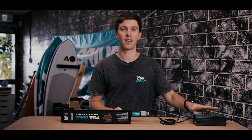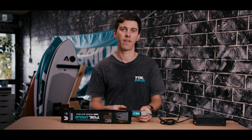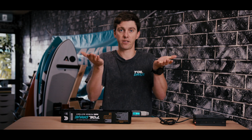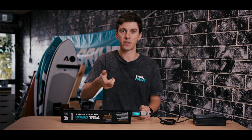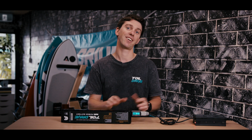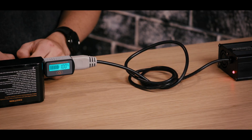Use the battery charger — when it goes to solid green, that indicates the charge is finished and you're completely full. Think of it like filling a bucket with a garden hose: you get strong water flow to fill most of the bucket quickly, then right at the end you're adding just little bits of extra water to fill it right up. You could walk away with the battery not quite exactly full and go ride your system, but if you want a completely full battery, wait until the charger clicks over to the solid green light.